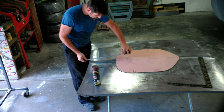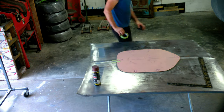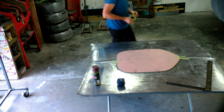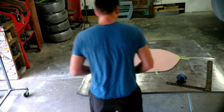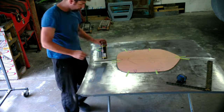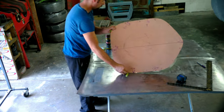Here's the part where I think the wooden template was key to this whole deal and made the project come out so much nicer. I took all the measurements I took off the Golden Star hood, set it on top of this hood where I had to go, also verifying my measurements from the shaker hood template. I taped it there, made sure everything's going to line up, and we know this is the actual size of our shaker ring because we ground it right down to the edge of it — it's perfect. Once we have it centered, we can trace this around and know exactly where we're going to put our indentation — the recess that sets the shaker trim into the hood. There's really no guesswork here. This just made the process easier.